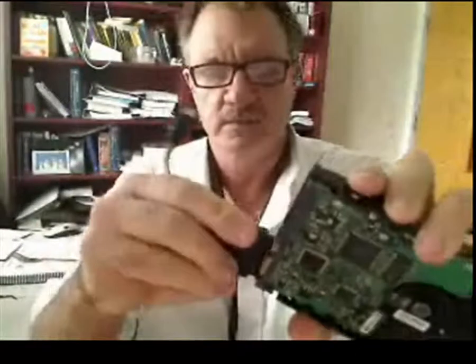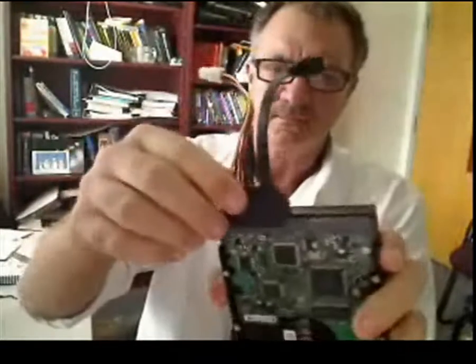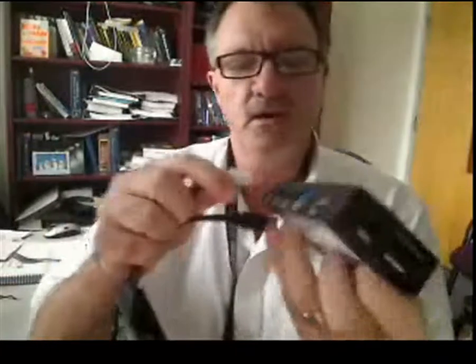The first thing we want to do is connect the SATA connection right here to the hard drive — like this — and make sure that's firmly put in. There's a forcing function so it can only fit one way, so you know it's done correctly. Then on the back here is where the power supply connects, and that goes in with the pin up, as you can see.